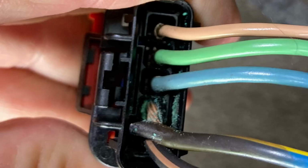All right guys, that's going to wind up the blower repair for the Dakota. Wasn't too bad. Replaced that resistor. You can see where it was burnt. Replaced the wire harness connector as well. It was burnt as well. All of this was like 40 bucks between the two pieces at O'Reilly's. So anyways, we got our AC blowing again, and maybe this little trick helps somebody that's in the same boat I was in.